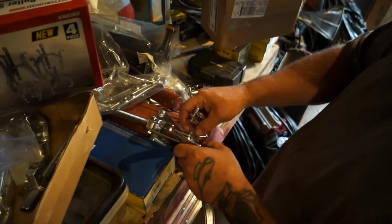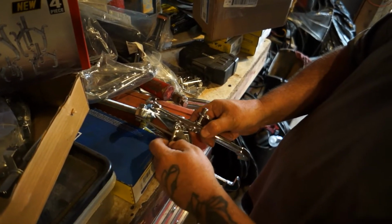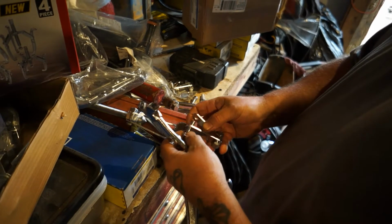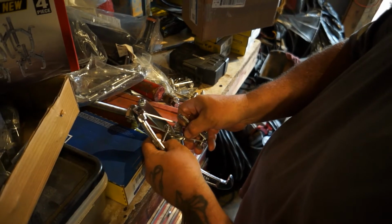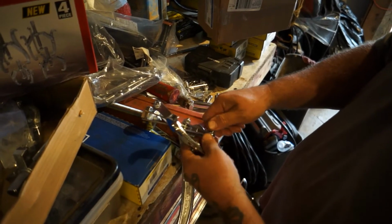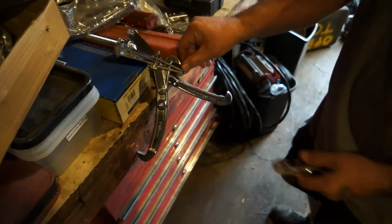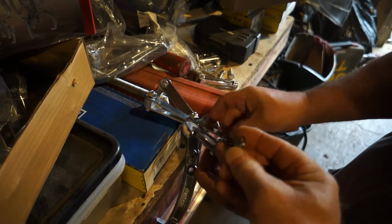He's just taking apart that puller and he's adding some extra arms on it. That should be more than long enough, hopefully not too long. Rather have it a little too long, we can always figure out a way to shorten it up later. If not, we're going to custom weld some brackets or a chain or something that's going to be the exact match for what we need. So he's just putting 2 extensions per arm, and he took those off of, here, I'll get this. We basically just robbed it off another puller that we had in the kit here.